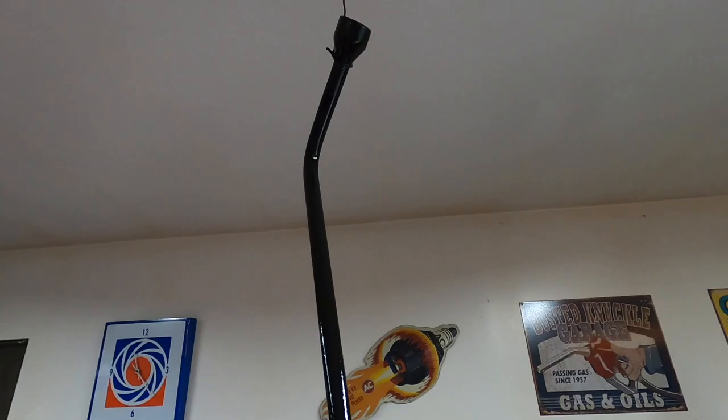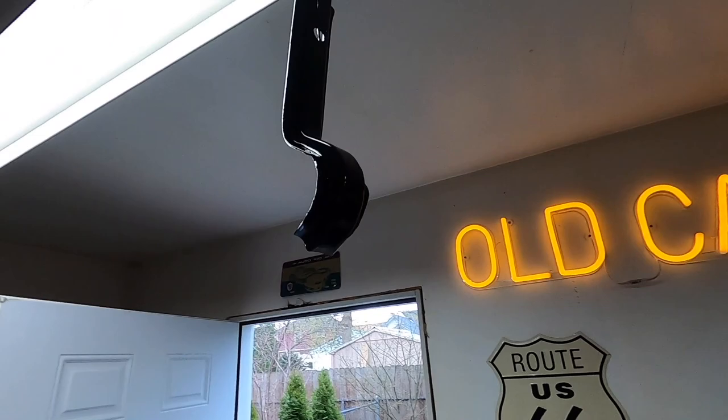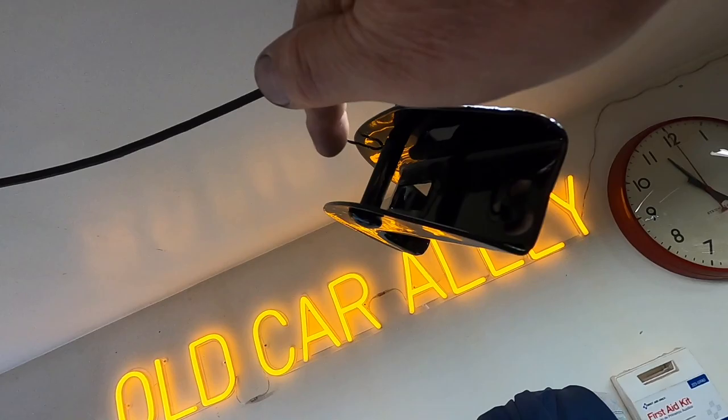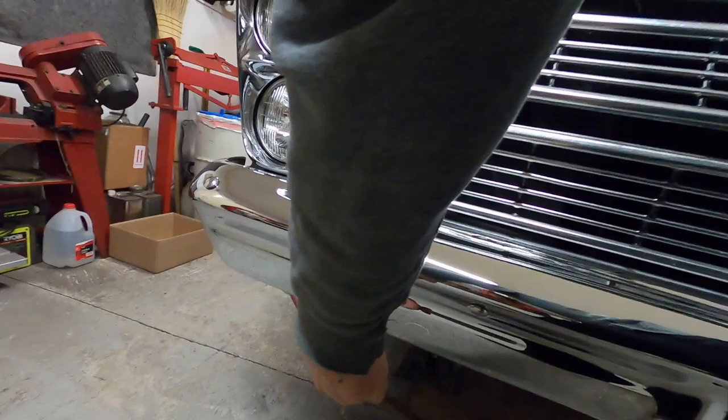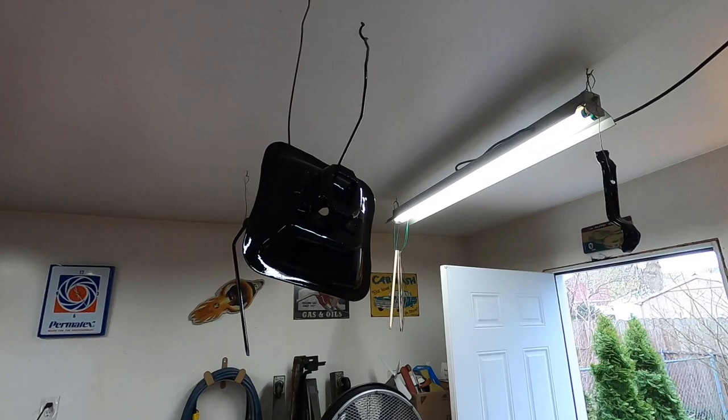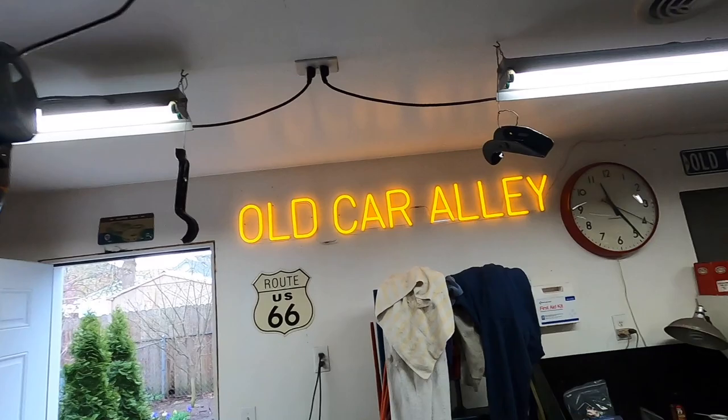That looks really good. That's what holds the jack and the tire iron in place. And that's the part that goes on the bumper. That big heavy bar there clips into here, and then it hooks on the bumper. And this car, as long as I own it, is never going to use a bumper jack. If I can't change it with a bottle jack and what I have in the car, I'll call road service, because bumper jacks are just dangerous. I don't even know why they even made them.